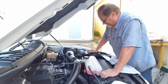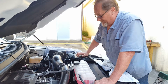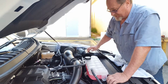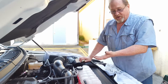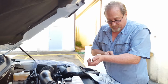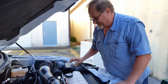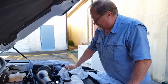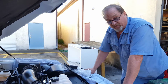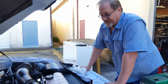And we've got no vacuum leaks, no check engine light, everything is running properly. So what we're going to do next is we're going to add the drain tube, and we're going to have that extend just slightly out the bottom so a oil drain pan can be placed under there. You're going to want to check your can when you first install it at about 500 to 1,000 miles so you can determine what the consumption rate or fill rate is of the can on your engine.